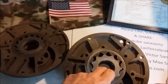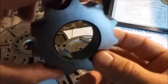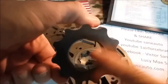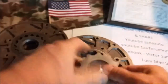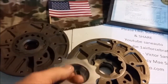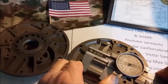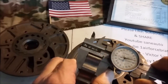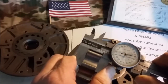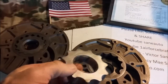Then later, from 78 to 90, you're going to have this right here with the two flats. Let me pull this out so you can see the flats real good. You see the flats right here? Now they've got a chamfer right here which points towards the torque converter and flat right here which goes back towards the stator. These is where it gets interesting because you can have pretty much an infinite number of thicknesses. They'll go from 0.7476 all the way up to 0.7497. This one happens to be one of the thickest at 0.749 and some change.